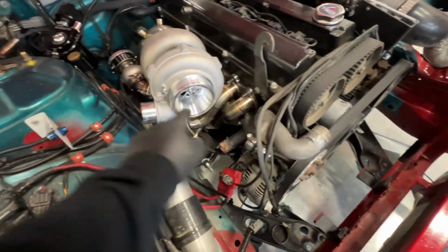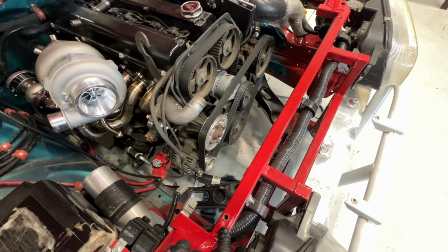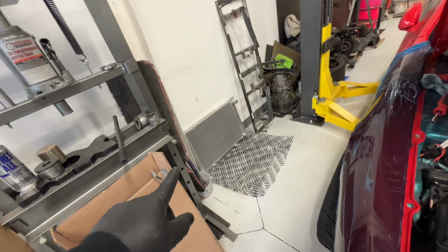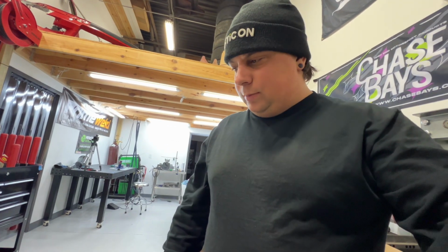Now I'm gonna end this video here and start the next video off with doing the swirl pot, modify the housing to mate up to the intercooler piping, probably cut this bar out, move it forward some, and make all the new mounting points for the new radiator, mount the fan on the radiator, add some thermocouples into the radiator as requested from the customer, Kevin and his dad. So I think that's the last of the stuff, and then Brendan's going to be installing a Link ECU